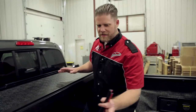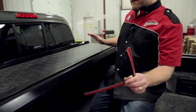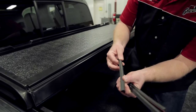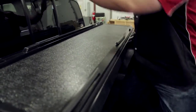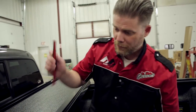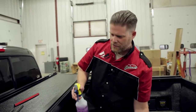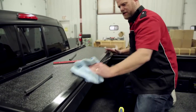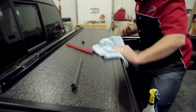Now that we've got the tonneau adjusted and locked into place and we're happy with the way it fits, there are a few last things we need to do to finish up the project. The first one is they give you these pre-cut cab saver strips that we're going to put along here, so if it bounces off the cab it's not going to affect the paint. Before we put those on, always when you're using an adhesive, make sure you have a good clean surface. We're just going to use some all-purpose cleaner to wipe this area down and dry it to make sure that we get good adhesion on the strips.